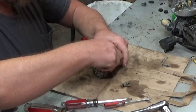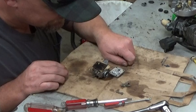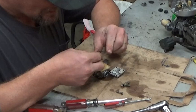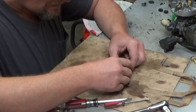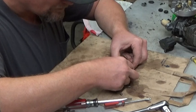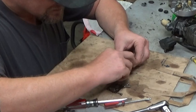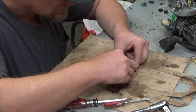Okay, so let's look at this as it comes apart and see if we find anything. I already know what it is. Gaskets are reversed. The diaphragm needs to be against the aluminum block. It's not sequenced right, though. That's the way it should be. That looks more better. Except it's still not lining up. Come on, dipstick, can you use your brain? And yes, I'm referring to myself. There we go. That is the way it should be.